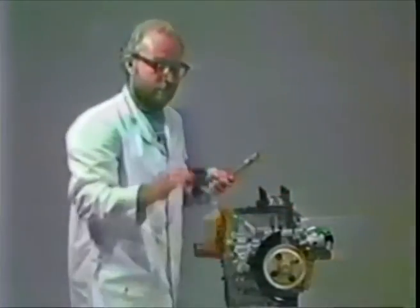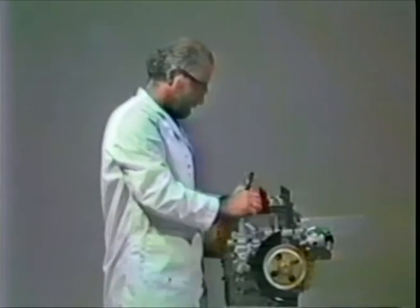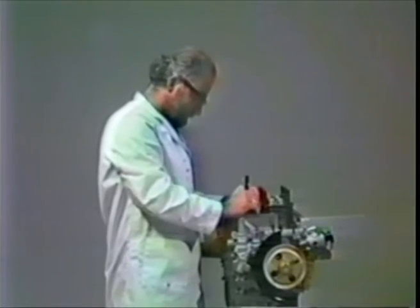I know we lubricated the seals on the pushrod tubes, but it helps to lubricate that too. Get out one of the pushrod tubes with the spring and retaining clip on it. Get out the air deflector. Do a trial test of fitting the cutout over the through bolt washer.